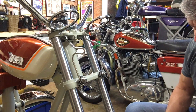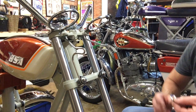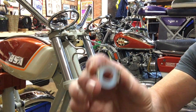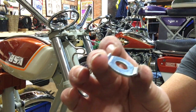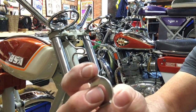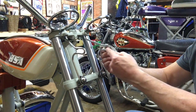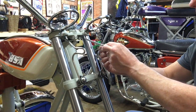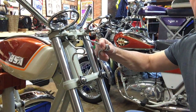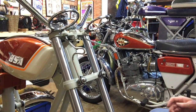And just what we need to consider then mounting this up is that you don't use standard washers on the headlight to go through the stays. Use special washers that have got folded over tabs on them, and those tabs should, if these are the right size, fit around the loop of the wire stay. And there's 4 washers, all identical, one on each side. The bolt goes through the middle and into the headlight, and then that secures the headlight onto the wires. So, but it does use the standard headlight mounting bolts, the chrome bolts. So that's an easy enough job to do now.